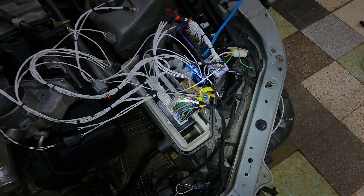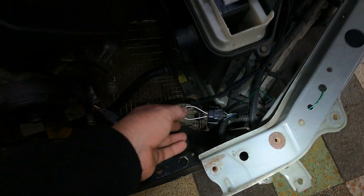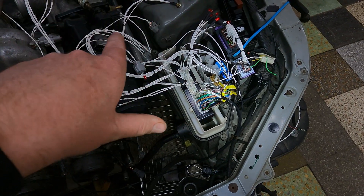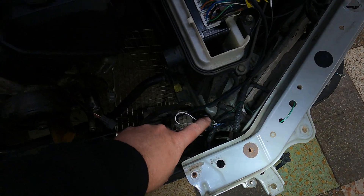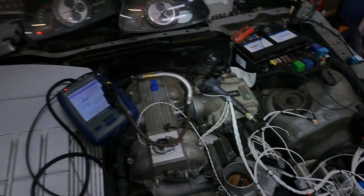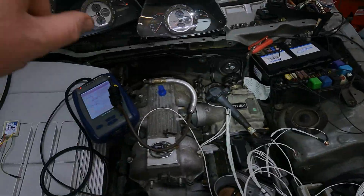We are running it through the ECU Master. Effectively, the MPX device gives out an AC request, and we then have the pressure sensor to show it's all okay, so the ECU turns on the AC magnetic clutch relay when the pressure goes to ground to indicate it's okay, and it gets the ground AC request from the MPX device via the car itself. So that's the whole AC system — we're happy with ambient temp and AC.